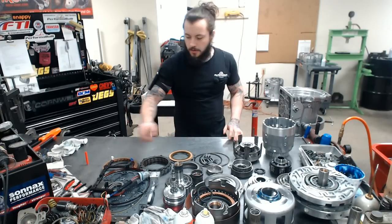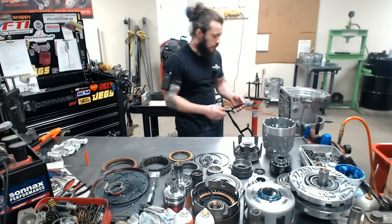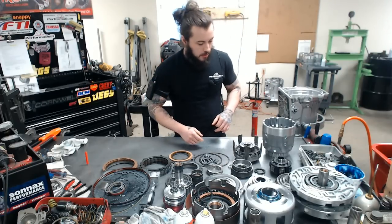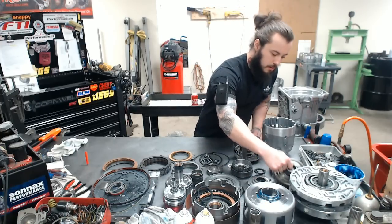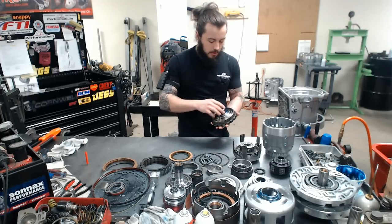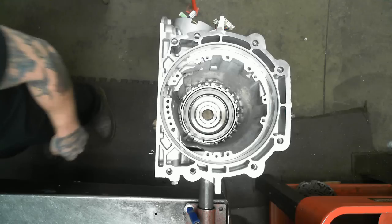So right now, I like to clear stuff off my desk that isn't really necessary right in the beginning, so I have room to work. Starting off by putting his wiring harness in, and that's just gonna simply clip in. Then I flip it around on my hook. Now the next part, we'll do this bottom up, and we're gonna start with the rear ring gear and the bearing. Little assembly goo. And give it a spin. As always, check your action.